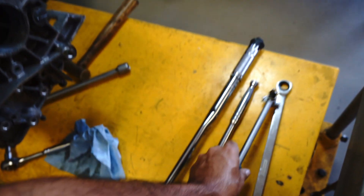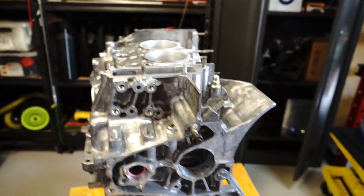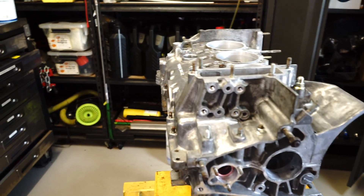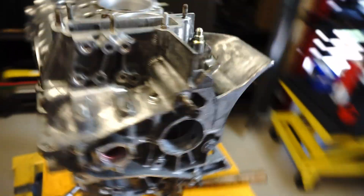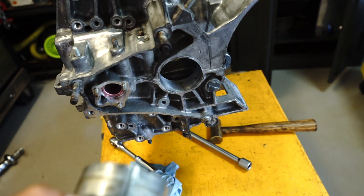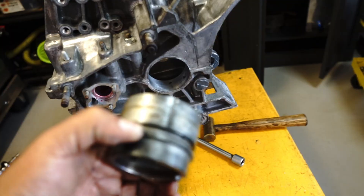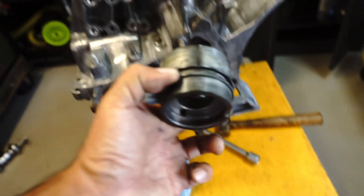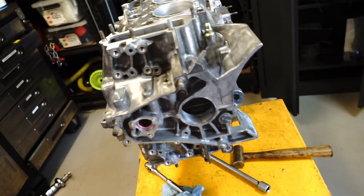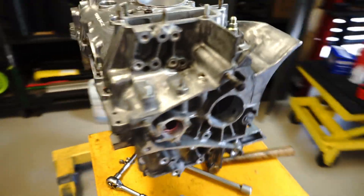Just in case anyone's wondering how accurate I'm being: the temperature is pretty constant in here, pretty cool, about 20–21 degrees. When I put the case together I actually do put a nose bearing in there to align the case, grease it up, then just loosely tighten the perimeter bolts, tap it out with a sleeve and slide hammer, then tighten everything up. So the case is in exactly the right spot every single time. Let's pull it apart.